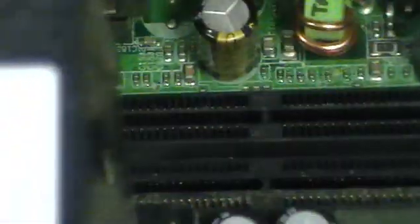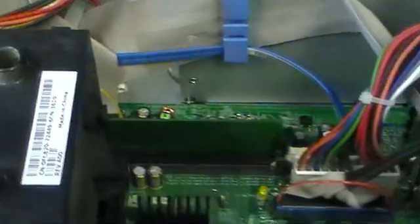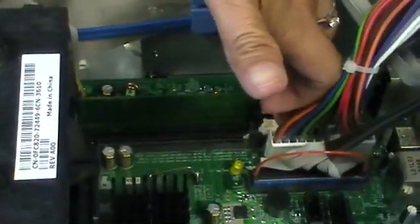When you put it in, it's going to fit right in there. Make sure these little handles are pushed all the way back, then insert your first chip. Make sure it goes in on that side and then on the other side. Apply a little pressure until you hear a pop and this little black or white lever grips the side of the memory chip. Push down with your thumb and you'll hear a little snap — that's all you have to do.